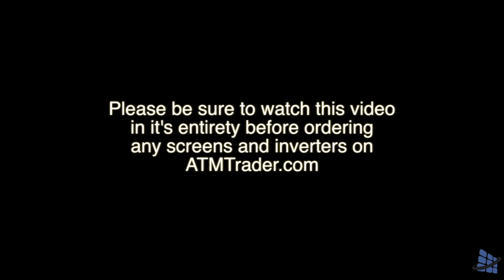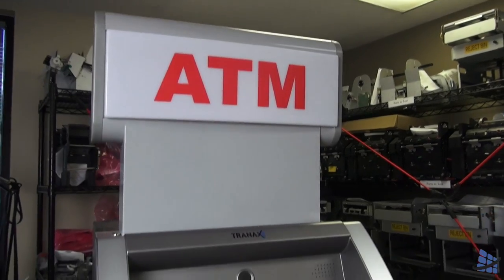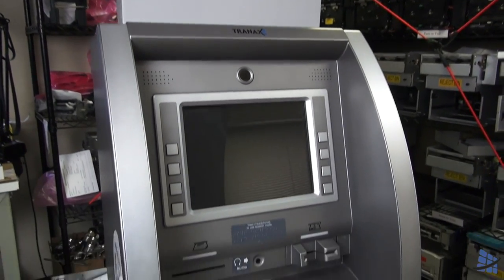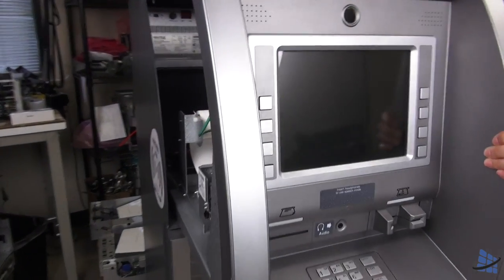Please be sure to watch this video in its entirety before ordering any screens and inverters on ATMTrader.com. When the screen on the C4000 goes out, it will typically be due to a faulty power supply, loose connection, or a bad screen and inverter.